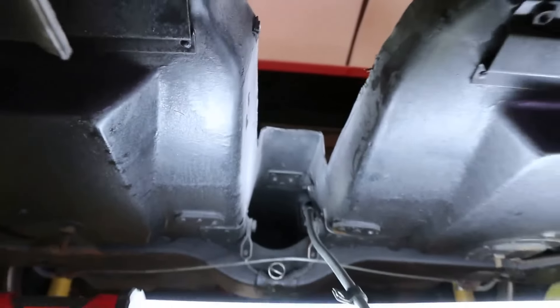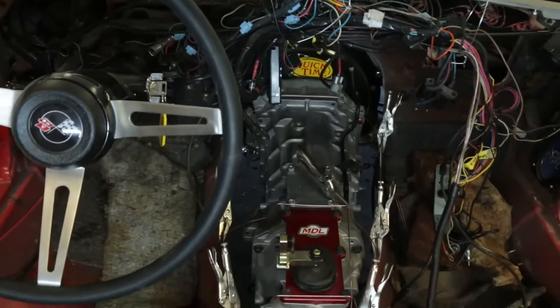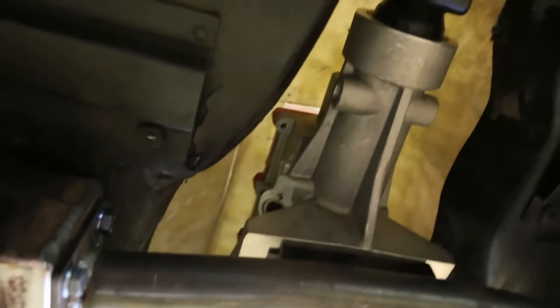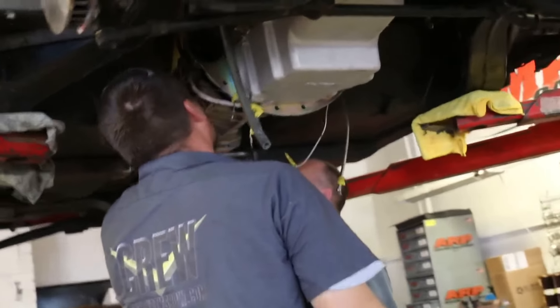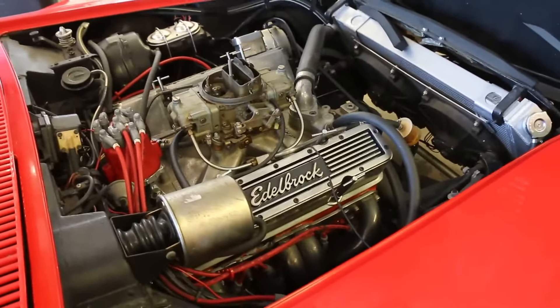Because of the Corvette's design, you cannot install the drive shaft unless the transmission or rear axle are out of the car. The clutch and pressure plate are attached to the engine, and the engine is lowered into place. One of the first things I noticed when we set the engine and transmission in the car is that originally the drivetrain is crooked in the Corvette — and GM did that on purpose. Driver positioning was a bigger priority than passenger positioning, so the engine sits offset toward the passenger side, and the back of the transmission isn't centered in the car either. We wanted to correct that because we're turning higher RPM and higher road speeds, and we didn't want driveline vibration translating into the car. We had the opportunity to fix it since we were already cutting up the tunnel and remounting the engine.